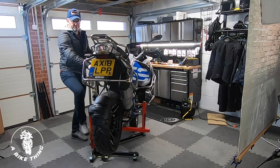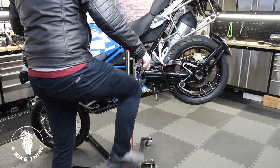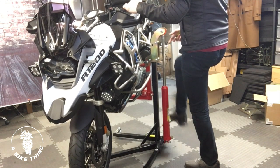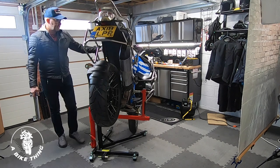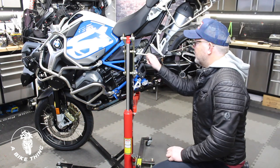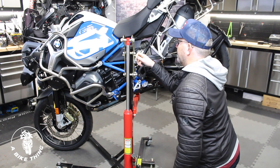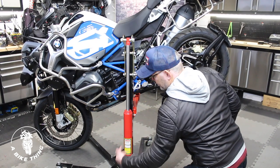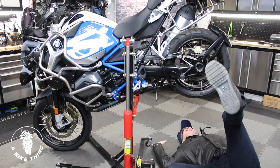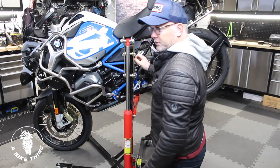So the front wheel stays on the floor. There's a maximum position here, and I can hear the gas escaping at the top. There are several points along here where, if you don't want to put your faith in the gas chamber, you can just put the locking pin in position. If I let it down a fraction and drop that in, then loosen off the valve — it just drops into position. That cannot drop on me. I can quite happily sit under this bike knowing it's not going to drop, because that bolt goes straight through — it cannot drop.